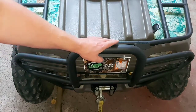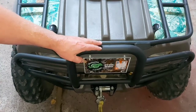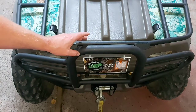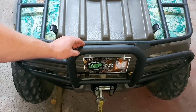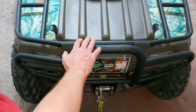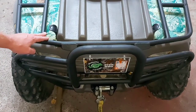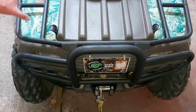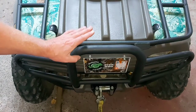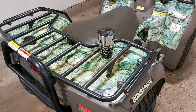The front racks were scuffed up, any rust areas were sanded right down to bare metal, and then given a couple coats of bed liner spray. You can see these look brand new — they have a textured finish and they're flat black. I'm noticing on a lot of newer ATVs this is the finish they're going with. So instead of having rusty old scratched-up bumpers, they look brand new, and it's quite cheap to do.